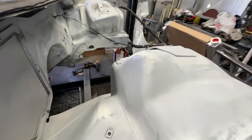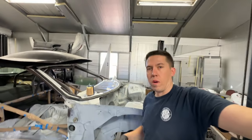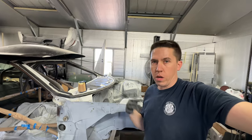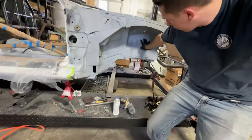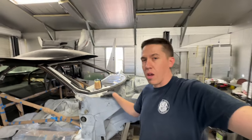There are a few little rough spots in here that I need to hit. I definitely don't want to glaze the whole bay and smooth everything perfect and add the weight back with body filler because we're trying to keep it thin. That's why we got rid of all the undercoatings. You'll see all those spot welds when it's painted, but we are going to paint it the arctic white to match.